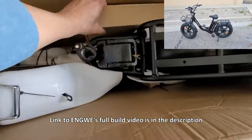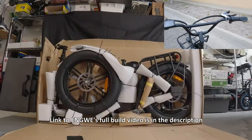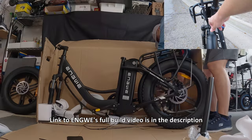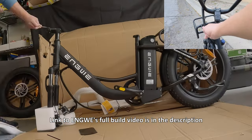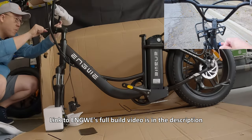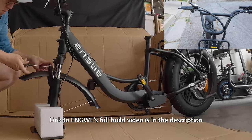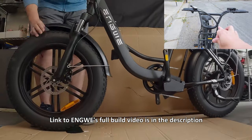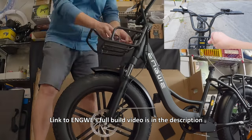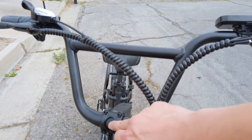Overall the build of the bike was fairly straightforward. You have to keep in mind that the cable coming out of the bottom has to be on the left because the rack has a little retention bar that holds it in place as you're turning the handlebar. If you put it on the other side it won't actually work — it's going to be too short if it's wrapped around the other side. So that's a mistake I made. You have to make sure it's coming off of this side and of course it matches the rack.